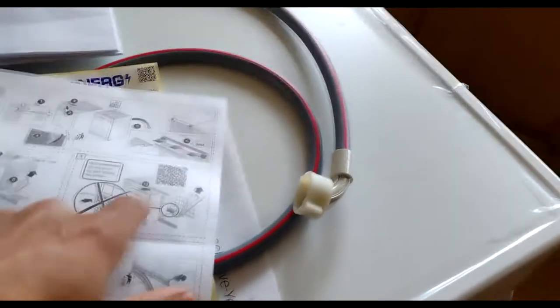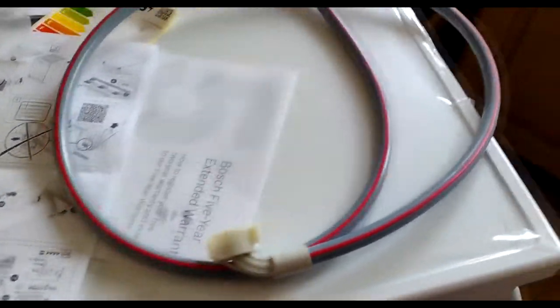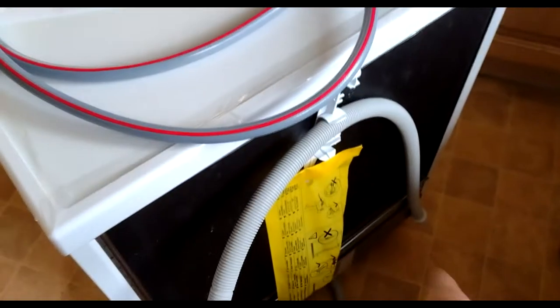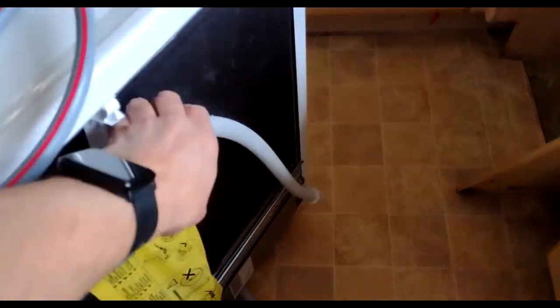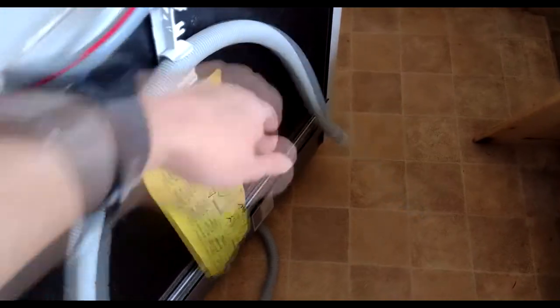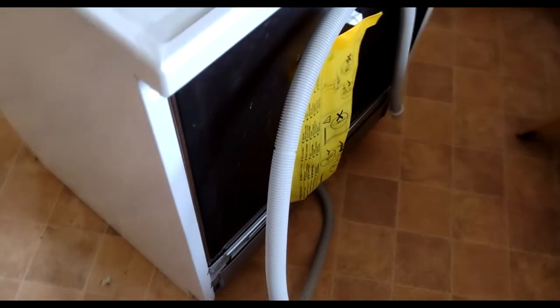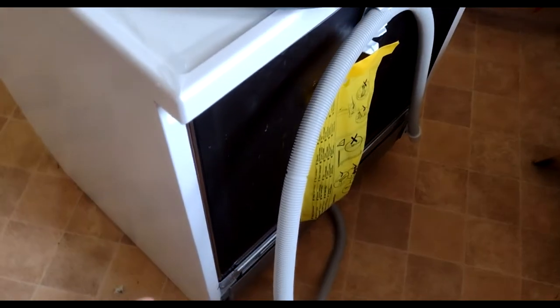Just as a recap: we need to connect the inlet pipe - one end to the dishwasher, with the angled end fitting into the back of the dishwasher. The exhaust line is already connected one end - the other end will go to the drain underneath the sink. The electrical cable connects one end at the lower bottom left of the machine and the other end to the socket on the wall.